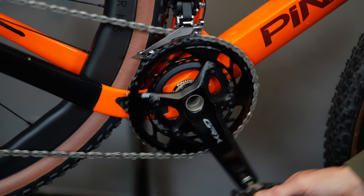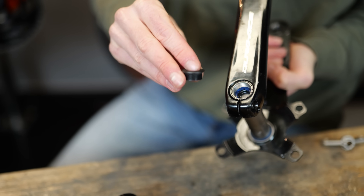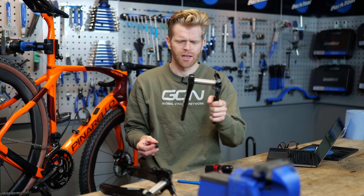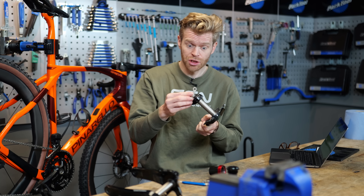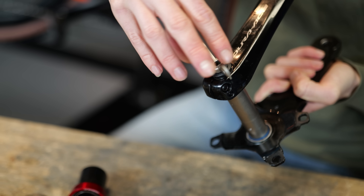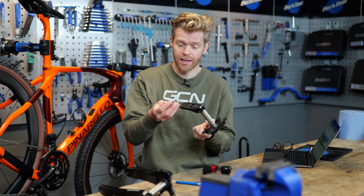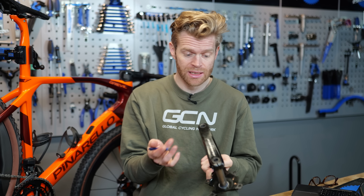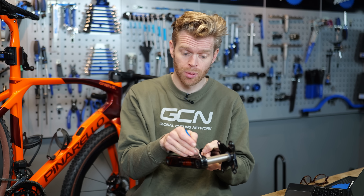Where do you typically see this? On cranksets, it's most common on Shimano and SRAM DUB cranksets — there is a preload cap on the non-drive side crank arm. People often create too much preload by excessively tightening this. It should only be finger tight. The solution to all preload problems is to look up the actual recommended preload for the particular part and follow the manufacturer's guidelines. These preload bolts are not designed to hold the crankset together — they're there just to remove axial play in the system before you tighten the important pinch bolts.